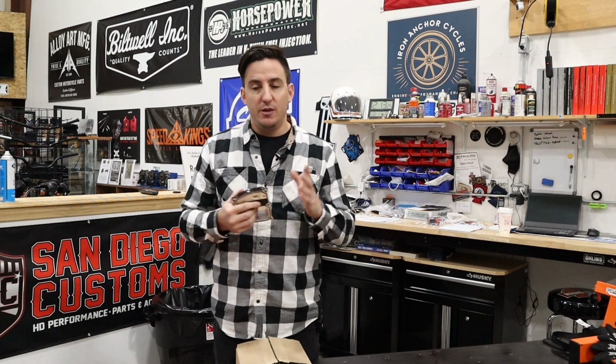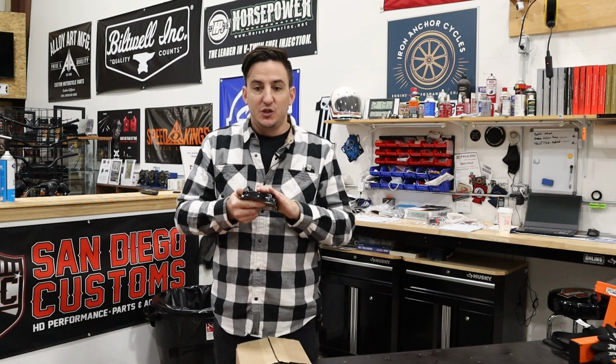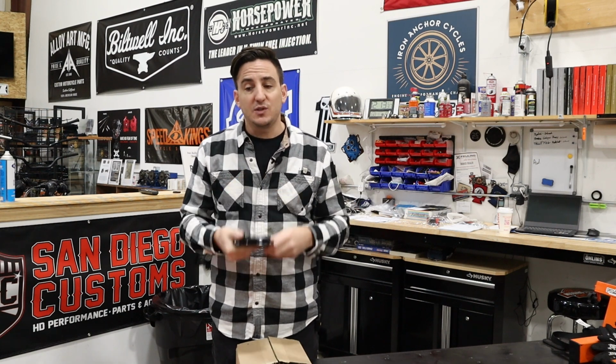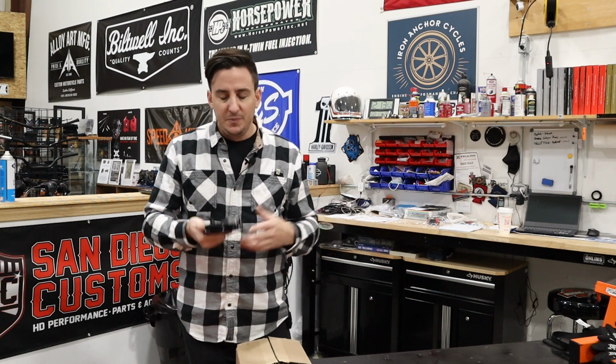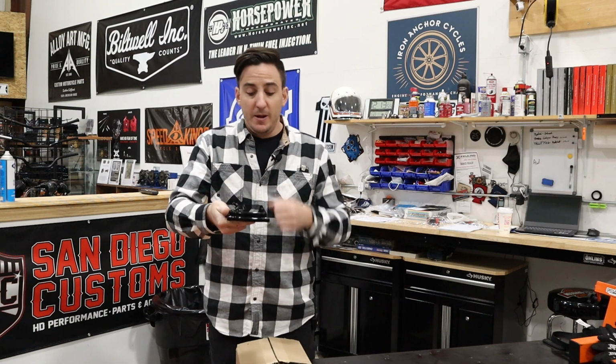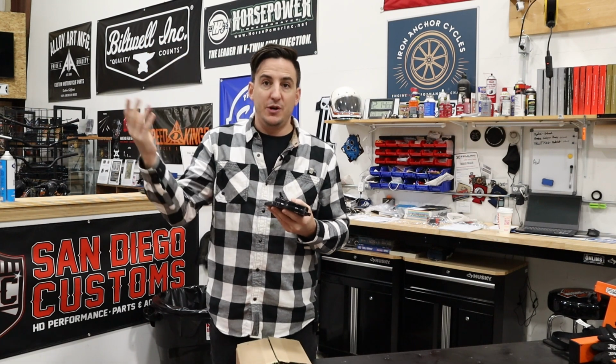So you're going to put this on, comes with a new gasket here. Not hard to do. The only thing I would say is, you may need to get a little creative with the wrenches that you've got to be able to get in underneath the cylinder to get these off, but certainly on the baggers, this can be done even without taking your exhaust off. On the Milwaukee Softails, in my experience anyway, you do have to take the pipes off. That rear head pipe gets in the way of getting to some of these. On the baggers, you can get all 6 from the other side, at least I can, so it's not a big deal. But even if you have to take your pipe off, it's really not the end of the world. Take your old one off, put the new one on, and plug in your hose, route it up on top of the motor, and you're good to go.